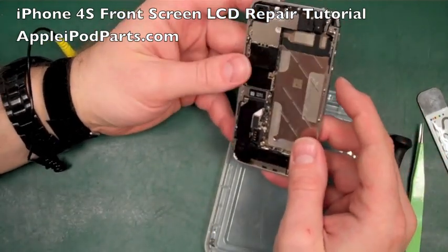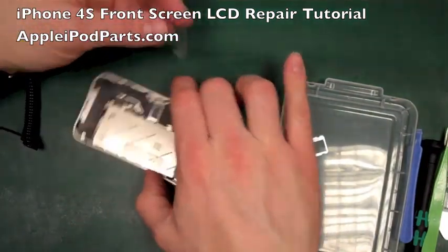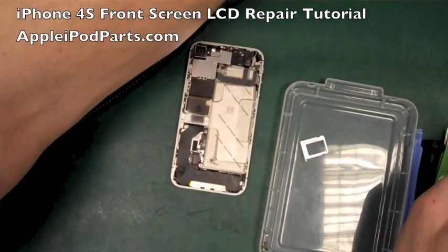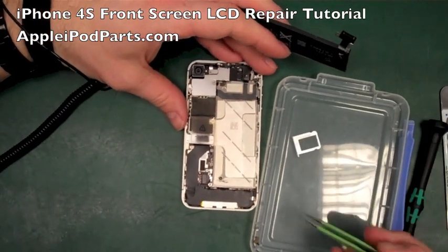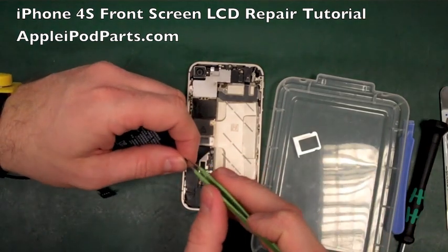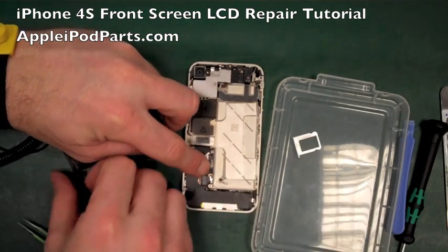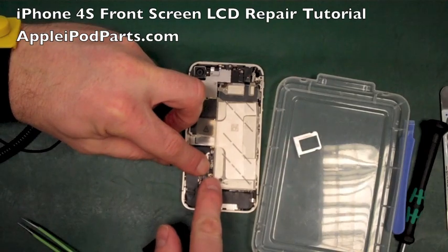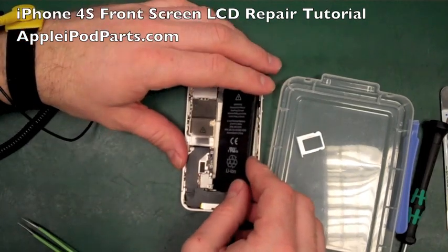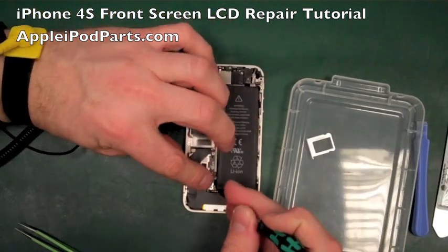Right, so that's essentially the phone pretty much assembled. Next thing we're going to do is put the battery on. So I'm going to put my adhesive for the battery, not adhesive, but the sort of pull flap, if you like, in place. Bring the battery over. Now, again, on the iPhone 4, a lot of people got this wrong, but this little bracket goes first, and then the battery goes in place. Sometimes it's better to do it first, sometimes you can do it afterwards. So you position that over there. The little prong points up because that grounds against the back casing, and then the battery connector sits in place over like so. Push the battery into the corner, sit it down, and then we can do the screws in there.